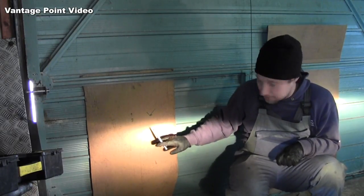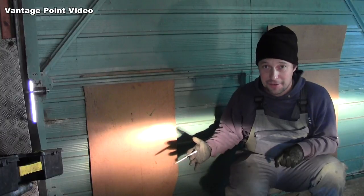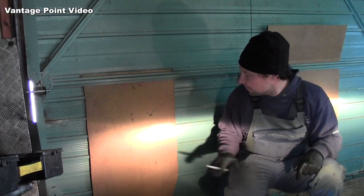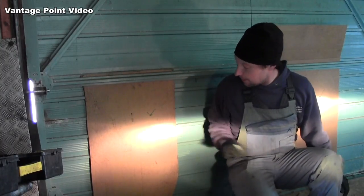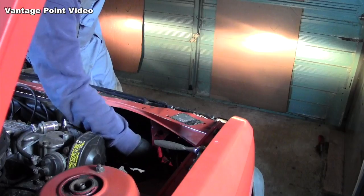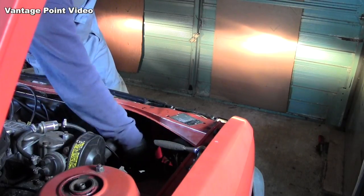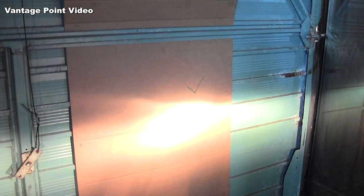Now I know this light is right, so I don't think I'm going to change that, and I'm going to allow that the error is actually that the car isn't straight to the door. I unfortunately don't have seven and a half metres of space to push the car back — that's how much you need to do this properly — but it's a nice enough clear image so we should be able to do a tidy. I'm going to actually bring this one down to match that one. I'll bring the bottom of the V across a bit with the new light. We've got it there.